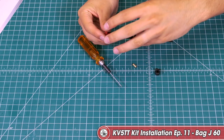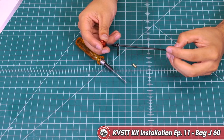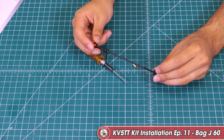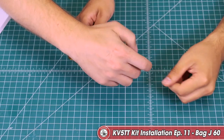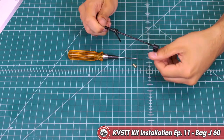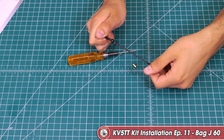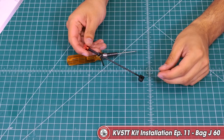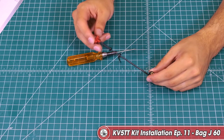Now slide all the bits and we're going to be threading on your brake pivot. There are two different sides, so have the nub side facing down. Thread it all the way until the brake rod starts to peek out the other side — flush here. We'll adjust the fit once it's on the car, but this is a good starting position. The good thing about this setup is once the brake linkage is on the car you can adjust it with the collar on the back. Now slide your brass bushing into place.